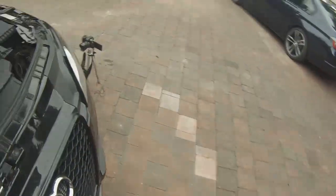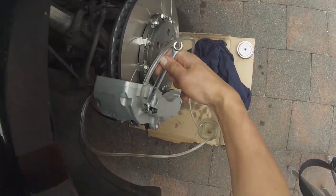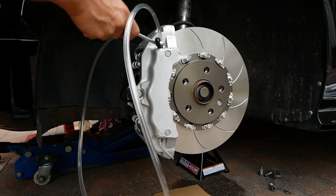I've never finished a VCDS brake bleed and not had a good brake feel. So if you find that your brakes are really not getting hard after doing a manual bleed or any other type of bleed that you have done, and you've not done a VCDS electronic brake bleed, then definitely consider it, because it might be your only way out from not getting a hard pedal.